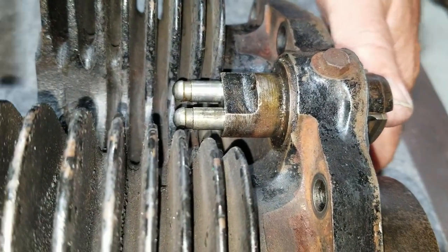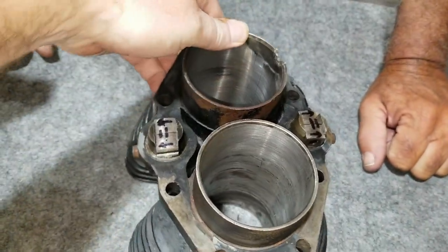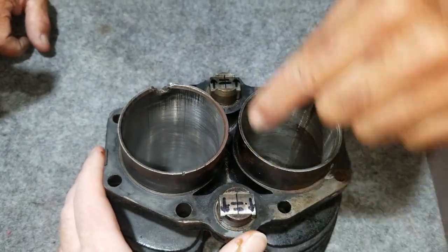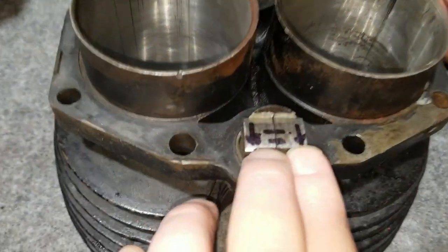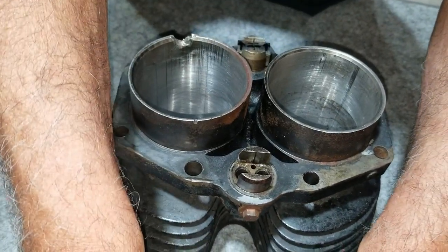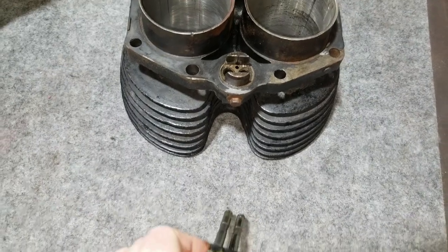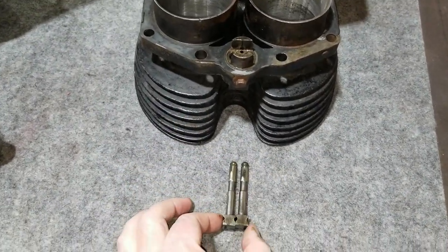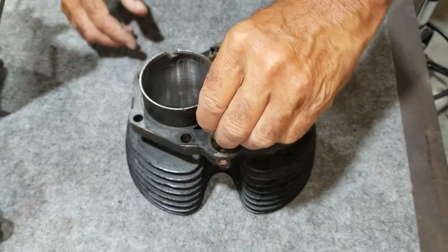Well, this is the base reason why that was like that, and we didn't know until we got this far into it. But anyways, this is all marked for no reason now, because we're going to get a new set. These are exhausts with the holes. These are intakes. That's going to go right back on the same places on the cam. We're going to reuse these lifters because they're in really good shape. And then we're going to get new blocks because, like I said, we need a nice, decent set of actual ones that belong in the cylinder we're going to be using. So, anyway, it's not a huge deal. That's why we marked them, so we can reuse them. Stay tuned, we'll be putting this in later, but just wanted to cover it right now. So anyway, stay tuned.